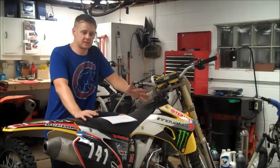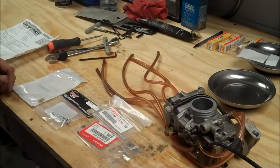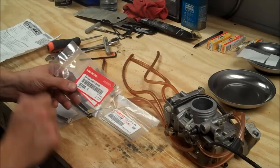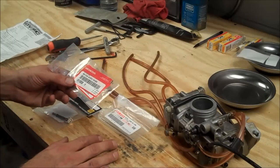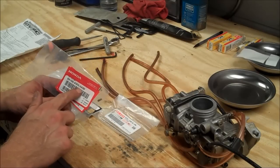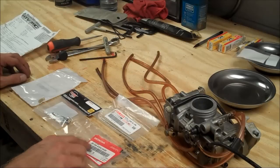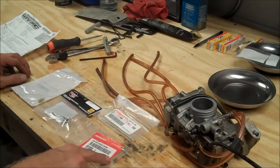Now that we've got the before ride in, let's tear the carb apart and I can walk you through how to jet it. Here's the carb on the workbench, and here are the parts we ordered. Here's the leak jet — you're probably wondering why it says Honda on it. Actually, all these bikes are equipped with the same FCR carburetors, and Honda does a nice job in their parts finder listing alternate part numbers. So this 045O is a 45 leak jet. Yamaha and others don't do that, so I just looked up an 07 CRF250R and found the 45 leak jet that way.